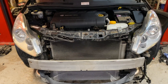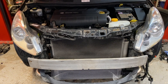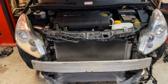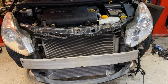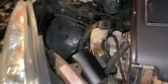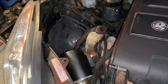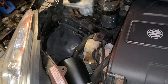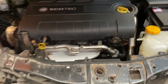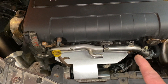I'm kind of getting to the limit of what I can physically do time-wise, because in essence I've run out of parts — everything's on order, I'm waiting for them to arrive. So let me show you where I'm up to and draw a line under it. Intercooler done, both boost pipes sorted, all the wiring sorted. The 90mm airflow meter I made — I've painted it black to blend in a bit subtle. I want this car to be a bit of a sleeper, so when you open the bonnet I don't really want everything in your face. Everything's in loom tape all the way through the car.